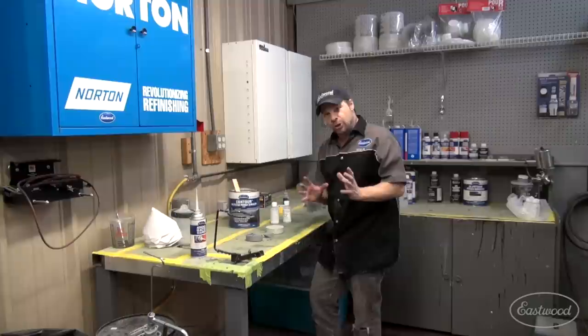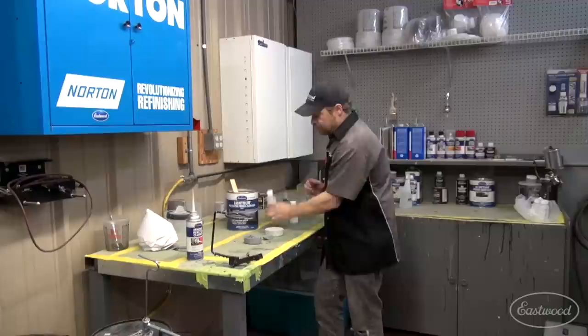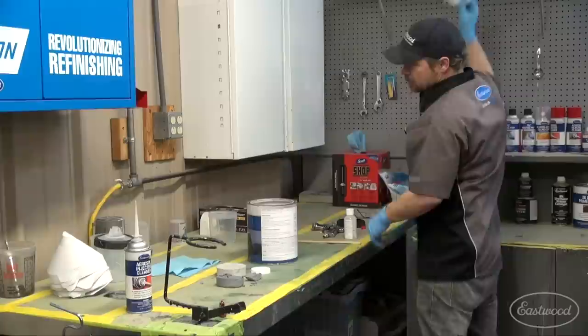Here's the easy thing I've figured out. They give you two of these hardener tubes per gallon of poly surfacer — four quarts, two quarts for each. I just mix a quart and pour half of one in, and you've got the right mix ratio. Pretty simple. If you don't have nitrile gloves, get them from Eastwood — protect yourself. No glove, no love.